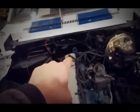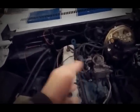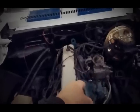A lot has happened since the last video — I have power brakes now. A neighbor, Jim, helped me get to where I am. I invited him over because I wanted to see if he had a tap set to help me put in a new vacuum port. Turns out that wasn't necessary. We took the PCV valve line and put it to a smaller emissions port, then took the port it was on off the multi-port stem and ran it over to the booster.